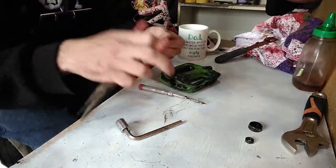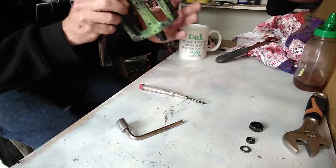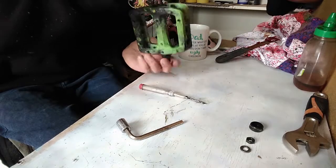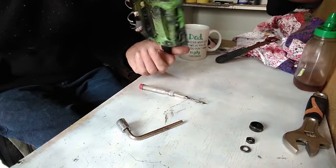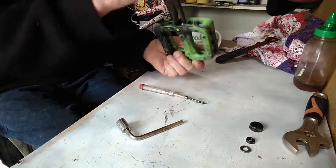Here we go. I've got a special lock washer. Little indents on the inside. Then the bearing housing nut. Now that's about 13, maybe a 14, but one of them. So, put in those pliers. Now these weren't done up tight, they're just there to hold the bearings in place.